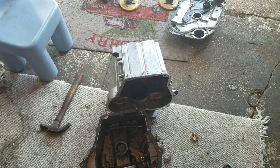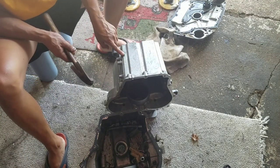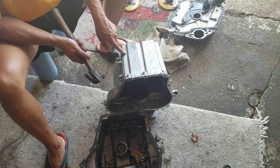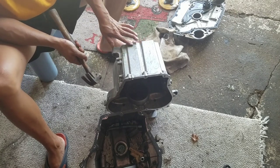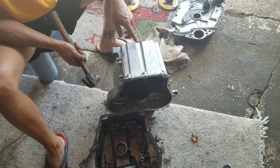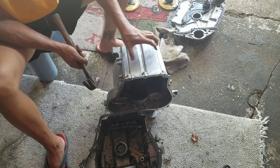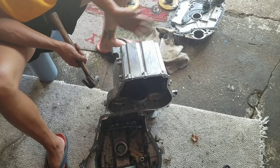So I took that other block to the back to rinse it, and I thought I'd play around with this crack over here and the crack over here. And I was banging it, and it actually pushed it in quite a bit. So I think actually this might be a better candidate for the block because the oil will sit over here, you know what I mean? And yes, it will still drip out and stuff, but I don't think there's anything that really moves around there. However, if I tried to seal that big hole on the bottom and put a plate there, I believe the synchro balancer is moving there a lot. So I could just see it touching that part and slowly scraping that piece of metal that I intended on JB welding there, and it might move, you know?